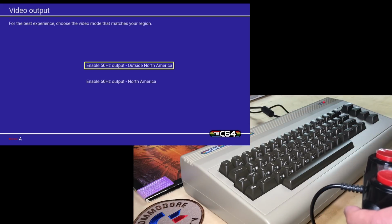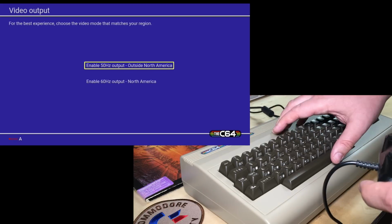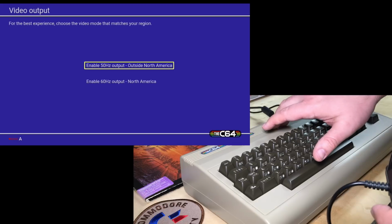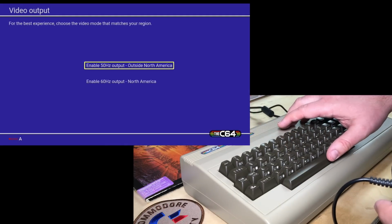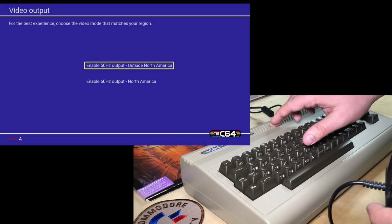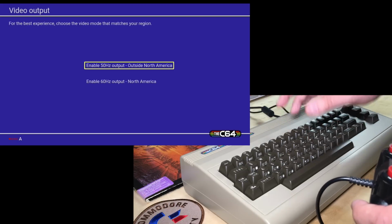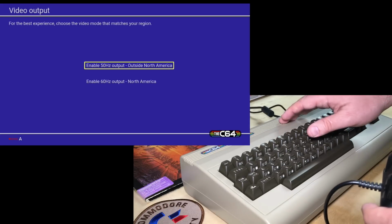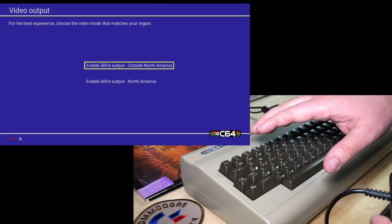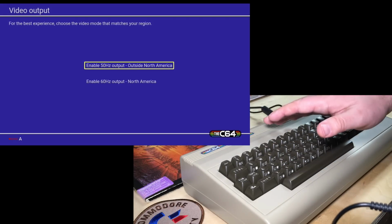If your video display does not support both of these modes, then it might automatically select 50 or 60 Hertz. If for some reason your display isn't compatible with the current version of the C64 firmware, maybe some monitors don't follow the spec right. If the display doesn't communicate that it's capable of both 50 and 60, then you won't get that choice. And the only workaround may be that you have to find another display that supports both, use that, and possibly if you choose it on that and then bring it back to your other display, it will start working. These HDMI devices have a computer in them, and they have to send the right information. Of course, the C64 also has to interpret that correctly. I'm not going to say where the fault lies.